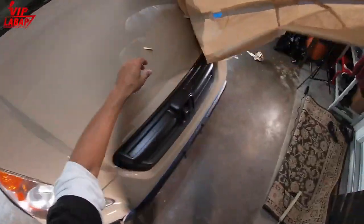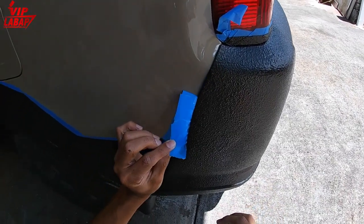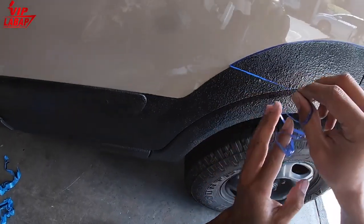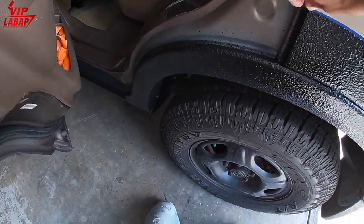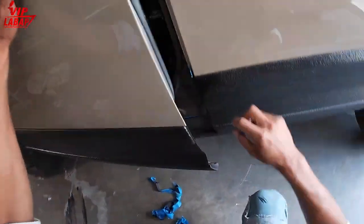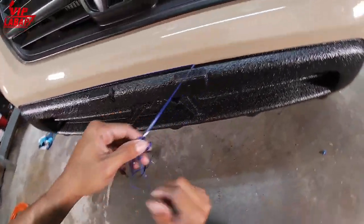In our VIP program we have a whole section on fine line taping for flame graphics or two-tone and three-tone masking. The 1/8-inch fine line tape by 3M is a very popular product we use all the time. When unmasking, take your time slowly. As for the masking tape, I like to use blue painter's tape on top of fresh paint because it doesn't have a strong stick — painter's tape doesn't have as good adhesion as 3M yellow tape or American tape, and for graphics I prefer a mediocre-adhesion tape so it releases cleanly.